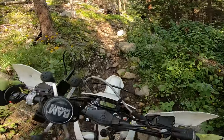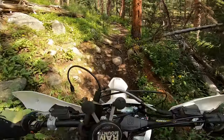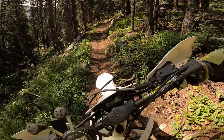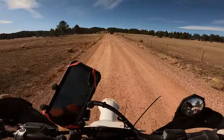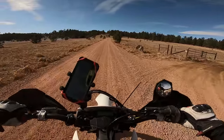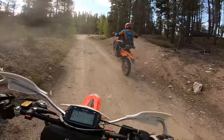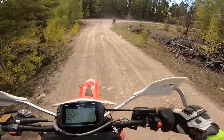In the first run you can hear it ping. In the second run I am more aggressive with the throttle, and notice the revs are higher but it bypasses that pinging sound. It's only when I ease into the throttle. I'm also going faster — if you pay attention to the speed on the first and second run.